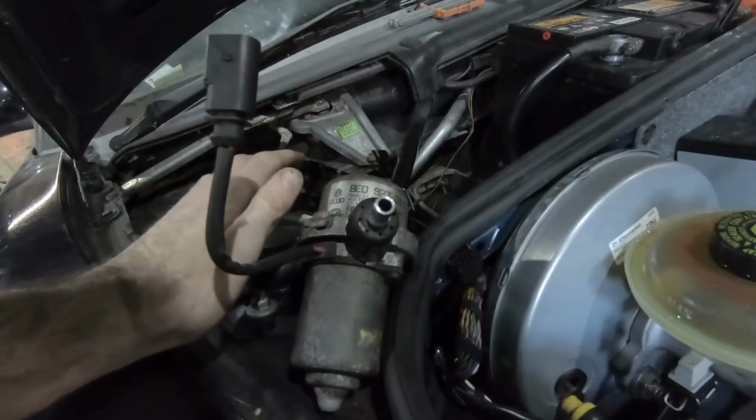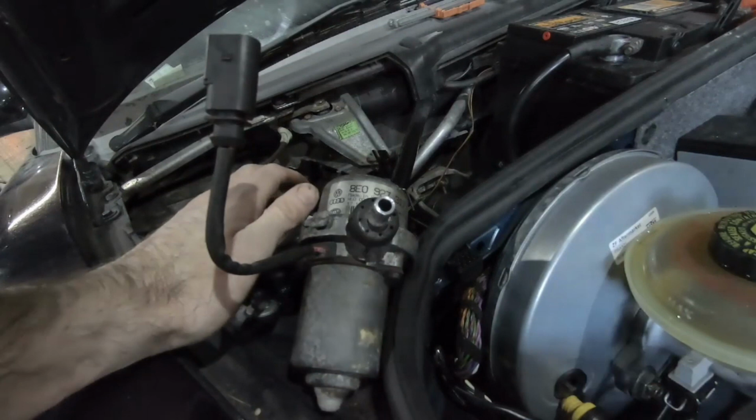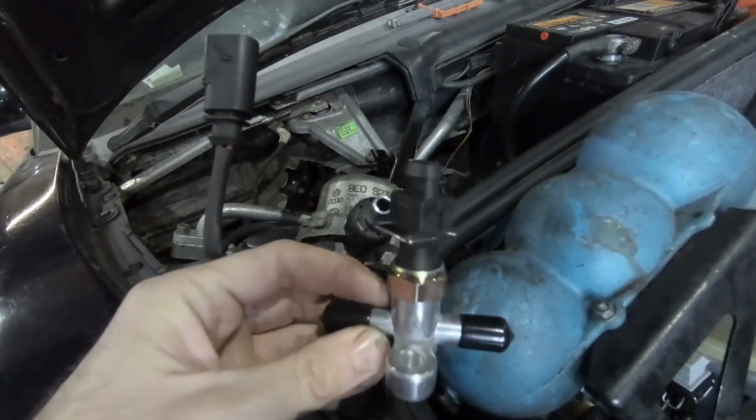And with that done, I decided also to try and sort out the brake booster. The vacuum's normally coming from the manifold in the engine, but obviously we don't have that. Fortunately, diesel cars don't produce manifold vacuum, so there are a lot of electric vacuum pumps out there designed for brake boosters. I got one of those from, I think it was an Audi, to keep it in the family or closely related to the Porsche. Got that plumbed in, a bit of vacuum hose and an on-off switch that detected the pressure, and we were good to go.